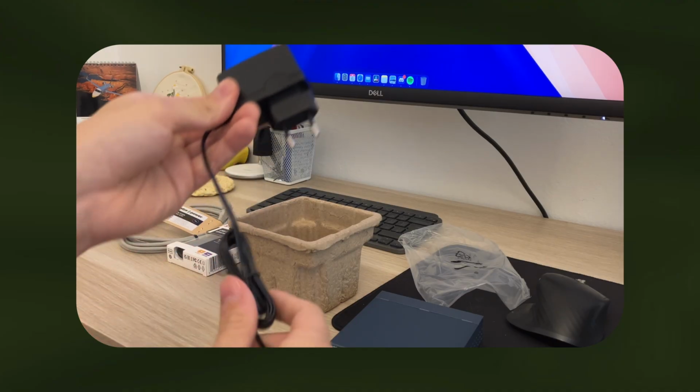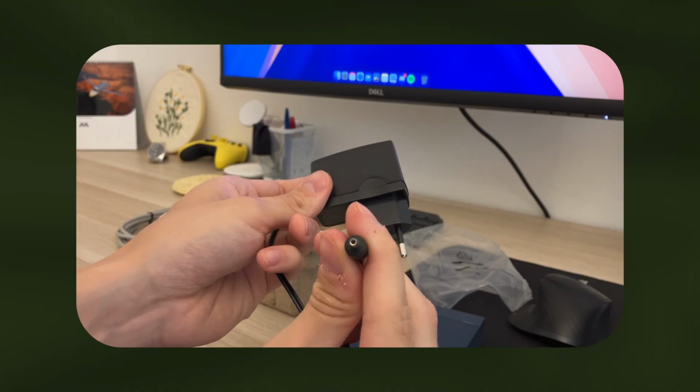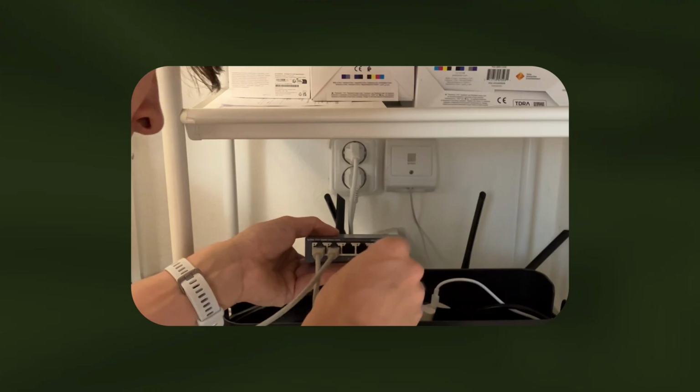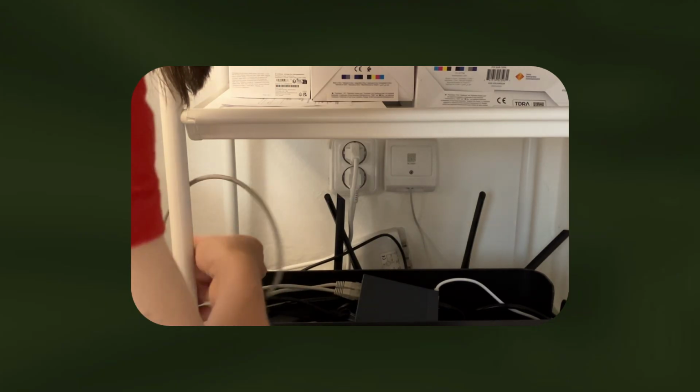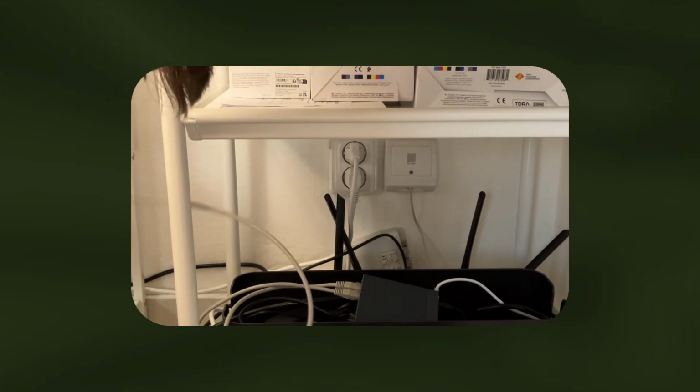One thing that this switch unfortunately doesn't have is PoE, Power over Ethernet. This would allow us to power the switch using the Ethernet cable. But since it comes with its own power adapter, I'm not complaining. After unboxing the switch, the setup is super simple. You'll need 3 Ethernet cables. Make sure that at least the 2 that are connected to your computer and your Raspberry Pi NAS support the gigabit transfer speed. Then you'll need the switch itself, your computer, and of course the Pi NAS.